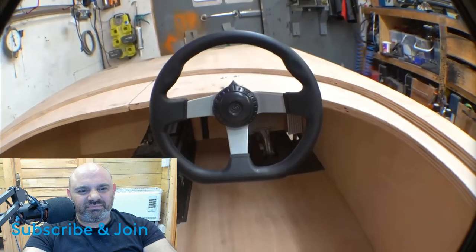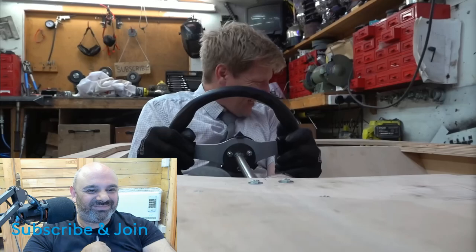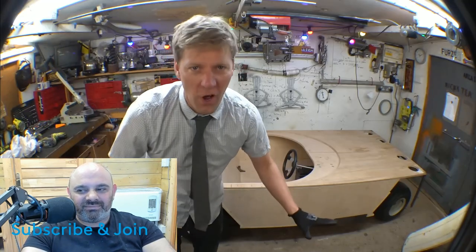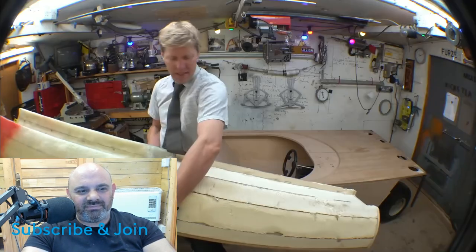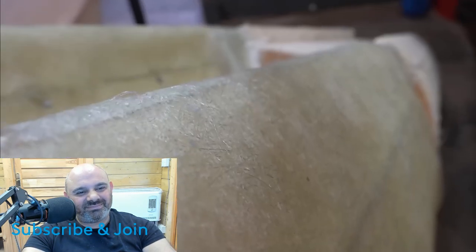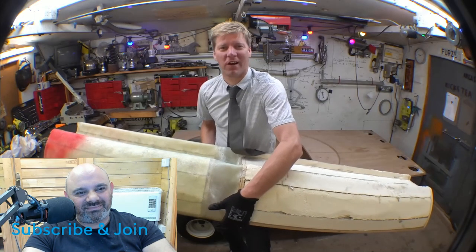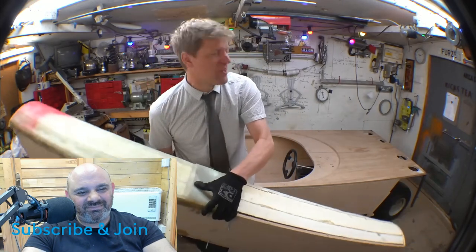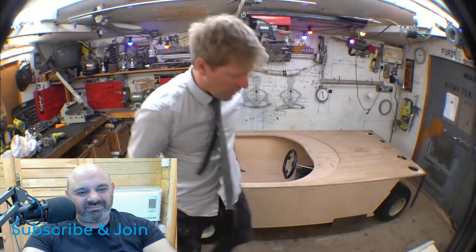Pedals, assembly, everything's down there. Steering column's all done. I think I'm a bit taller than Mark Hamill because it's a bit pokey for me, but I'll just have to live with that. Next thing we need to do is bodywork. I thought we'd fiberglass it — got a bit of plywood, shaved some foam down, made the rough shape, covered it in fiberglass and resin. Awful. It's not smooth, and by the time you smooth it all down with filler it'd take ages and weigh a ton. So I was thinking maybe metal is a good idea — I dismissed it originally thinking it would weigh too much, but this thing ain't light. I'm going to do it out of metal.